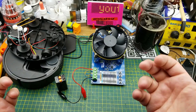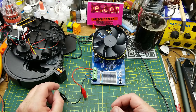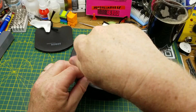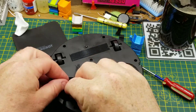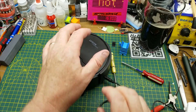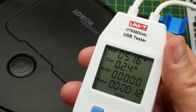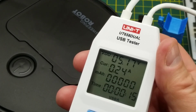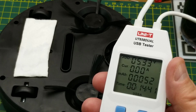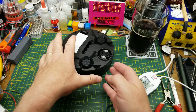There's nothing good about it at all — not that I expected it when I bought the thing. It was only 10 bucks on AliExpress. Let's put it back together and see if it'll actually suck up any dust. Plugging in the charger: it's drawing 250 milliamps, so that should take not very long at all. After less than 15 minutes, it has taken an entire 52 milliamp hours into the battery and won't take any more.